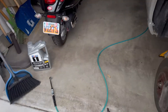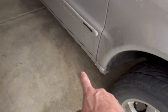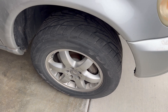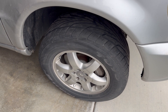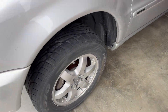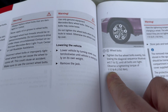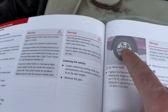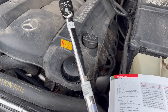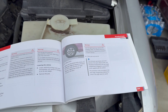Now we put the tires back on, moved front to back and back to front. Once wheels are back on all the way around, make sure they're snug with your wrench or socket — it's a 17-millimeter wheel lug size. After bringing the car down off the jack stands, go to the owner's manual and torque the wheels to 110 foot-pounds in a crisscross pattern. Be sure to use a calibrated torque wrench, get it calibrated every year, and if you drop it, get it calibrated again.